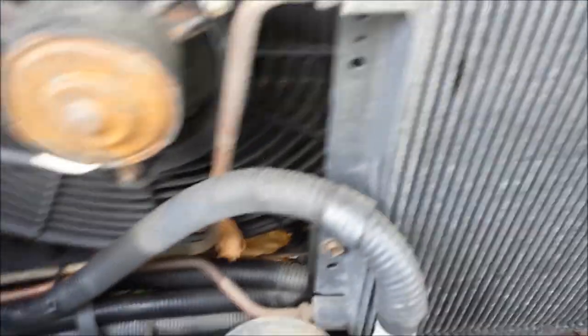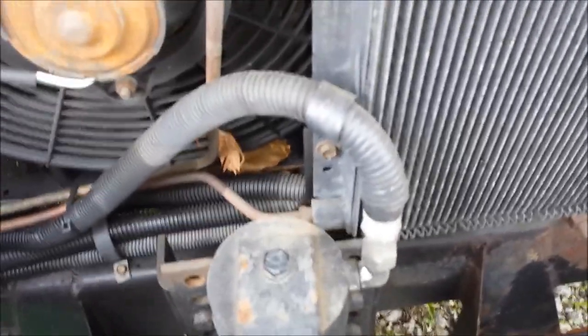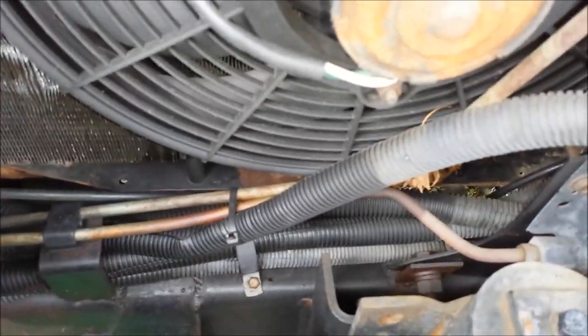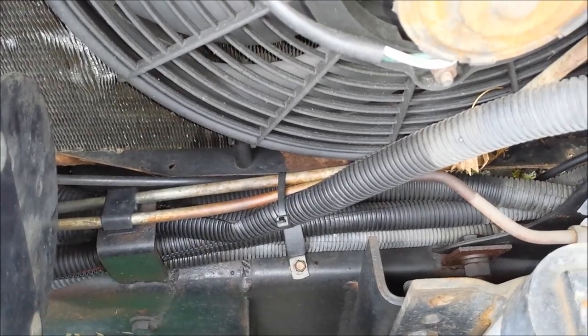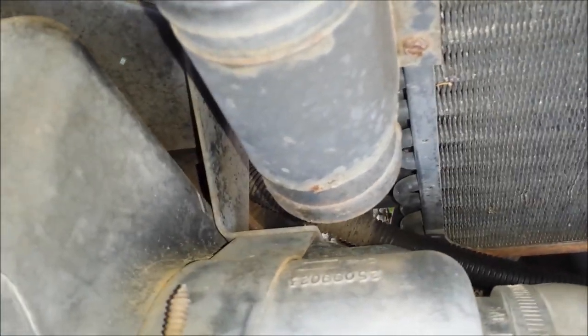What I did was come down and see this here is my line for my jack. So I followed my lines back through there. Now, you see there's a little bit of moisture there — I thought that's where it was coming from, but that's not where it was coming from. That's why I have the problem with having low fluid. I'll show you what that's from. You track that down — see, it goes way back under there.